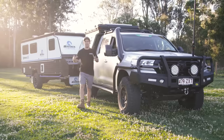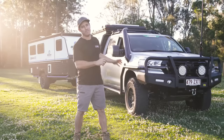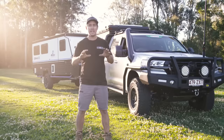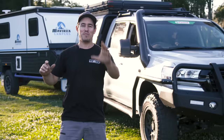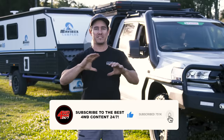Well, there you have it. Hopefully you got a stack out of this video on how to set your four-wheel drive up to be the ultimate tow vehicle. In my opinion it doesn't matter what make or model vehicle you've got — every single four-wheel drive can benefit hugely from a couple of key aftermarket accessories. We went through the top five and they're absolute essentials if you're planning to do a lap around Australia towing a big caravan, a boat, a camper trailer — something with a fair bit of weight behind you. Before I go, one last towing tip: your tow vehicle also needs to be heavier than the weight you're dragging behind you.